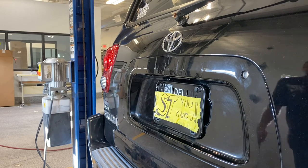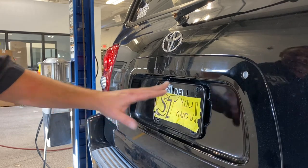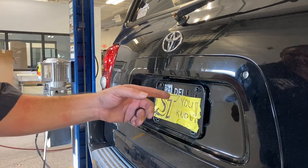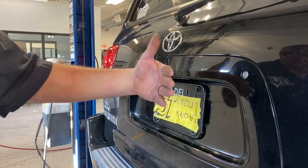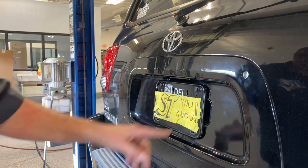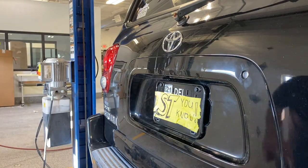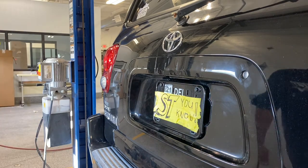This is one of those things — collision repair is about solving problems. It may not seem like that big of a deal, and in hindsight I probably wouldn't have had to take the inside apart. But I also wouldn't have known what was behind it. If I had run that tap in there too far, I could have struck something because this window goes up and down. Also, if I had to put a bigger hole in it I would have had to drill it, and definitely if I had to take a drill bit I would have had to find out what's behind there. Just another little project of stuff we do in here, and I hope you enjoyed it and learned a little something from it.